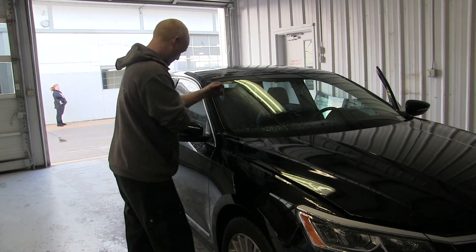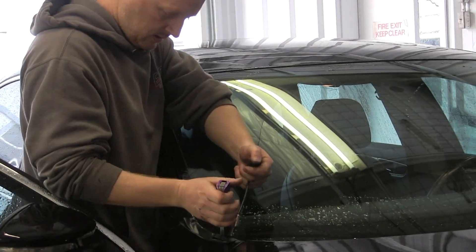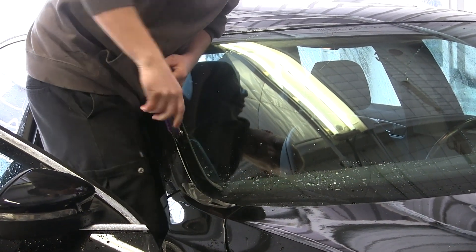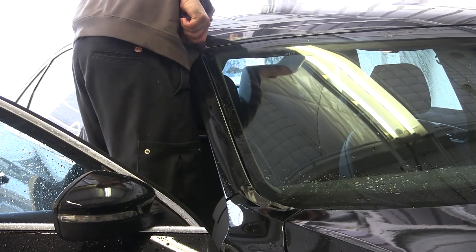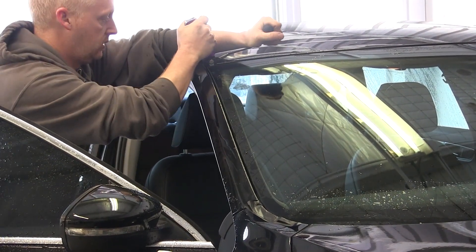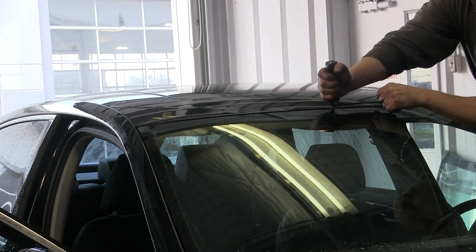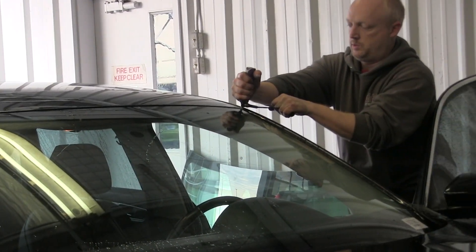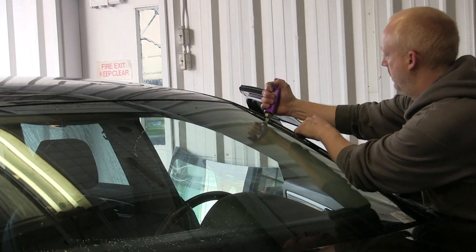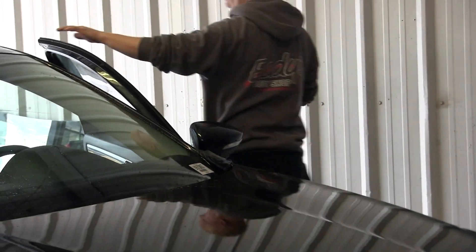He's protecting the corners of the fenders with some duct tape just to protect them if he accidentally hits them with the glass while taking it out — you always want to protect everything like that. Now he's going to show us a cold knife, and there is an art to this. He made it look like butter, even though it was cold. He said it works a lot better if the car is warm and that urethane has time to warm up. The technique is getting the angle of that blade just right. If you get a cold knife to work this easy and this fast, there's really no need to use something else.